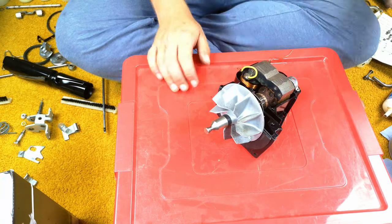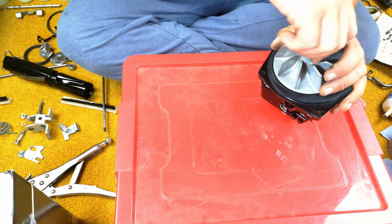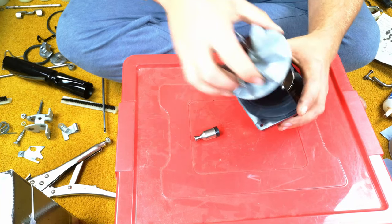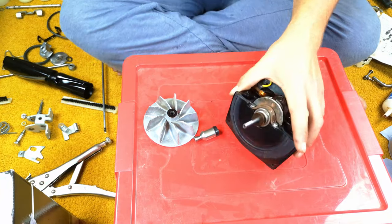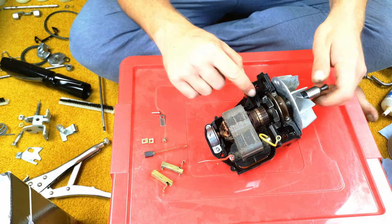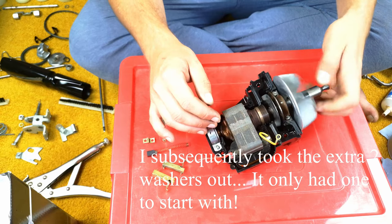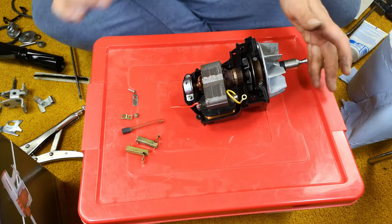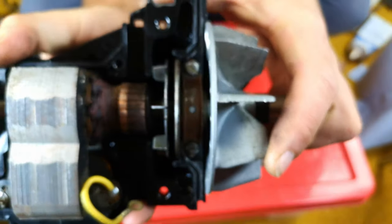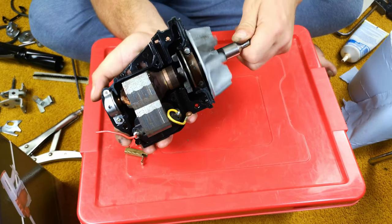That is not spinning very freely, so at this point we can grip it and twist it. What we need is another spacer washer. What it actually was was one of those cooling fans was just bent enough to catch on there — I did put an extra washer on it so it should be fine. I've taken out a couple more washers because you want the little space behind the fan, between the fan and the case, to be as thin as possible, whilst the fan free-spins an absolute treat with no real play in it at all. It all needs to be square — that is the first time you can really test it.